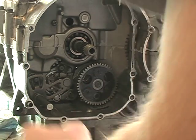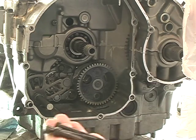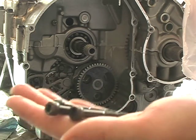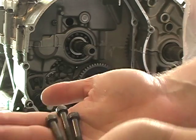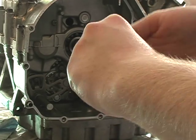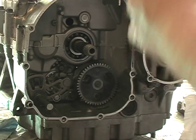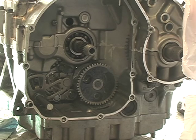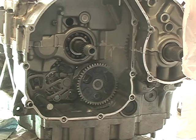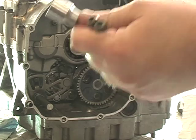I'm going to have to look at the torque specs on those. Three bolts for the oil pump — they're all the same size and length, and they are 7.2 foot-pounds. All these measurements, keep your FSM with you. They're easy to find on the internet if you need to get one or eBay one for $10 or something, just so you can be doubly sure. These are 5mm cap-head screws. I'm going to put these in now.